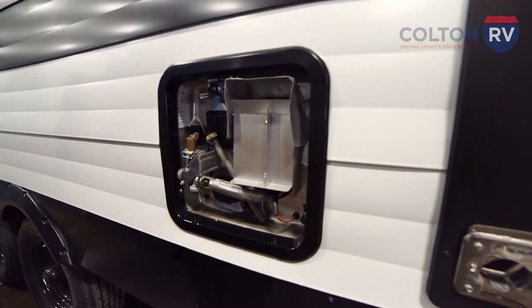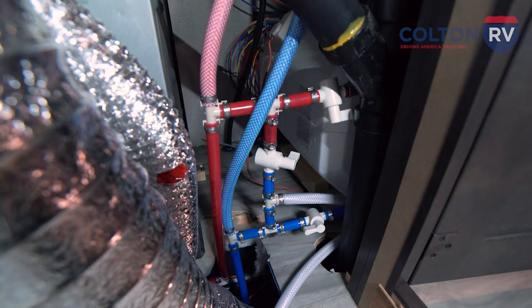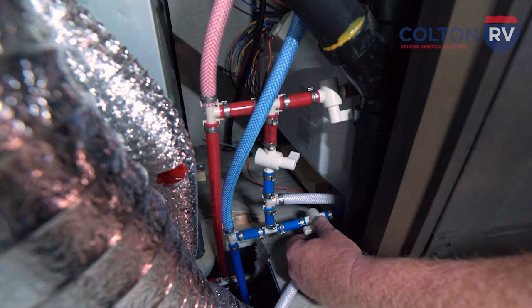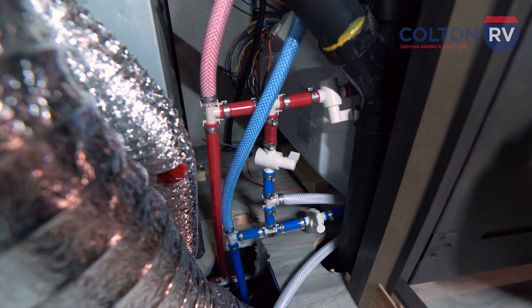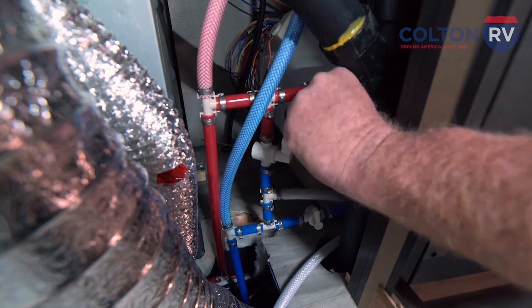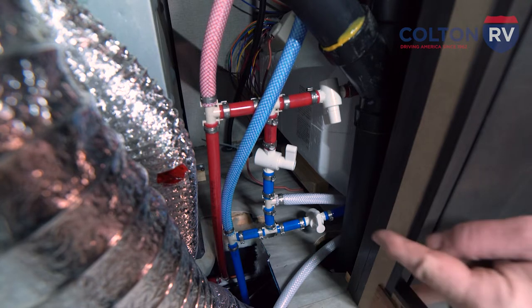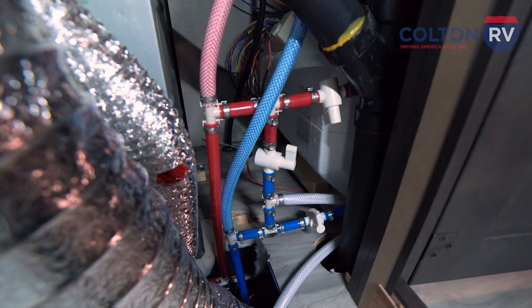Now that the hot water tank is drained, we're going to go back inside and flip all the valves to bypass the hot water tank. When it comes to hot water tank bypasses, there are three or four different models: a single valve, a double valve with a check valve, a three-valve setup, and a remote single valve. This particular unit uses a three-valve setup on the back of the hot water tank. Start at the bottom — turn the valve so it's across the tube to shut it off. This next one needs to be on so water can flow through it, and then this one you turn off so it's across the tube, stopping the flow. When you pump antifreeze through here, it goes up through the small line in the middle between the two and bypasses the hot water tank.